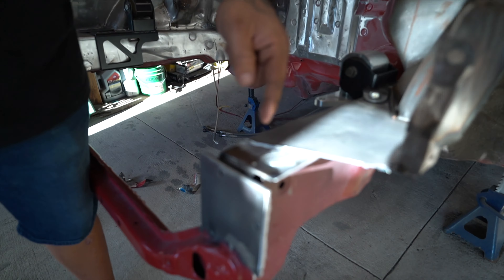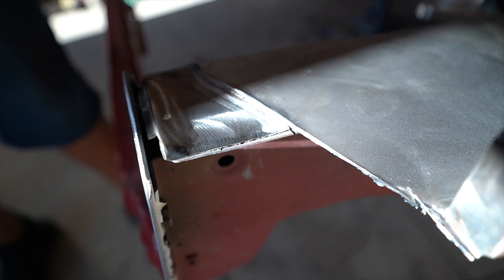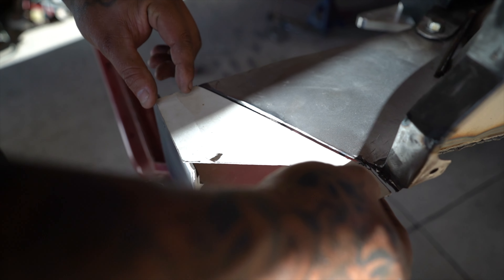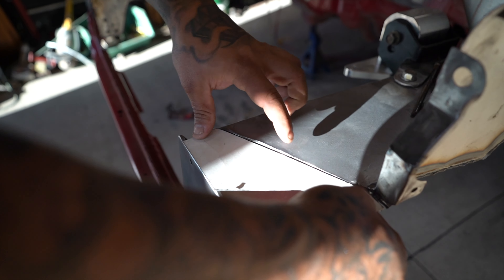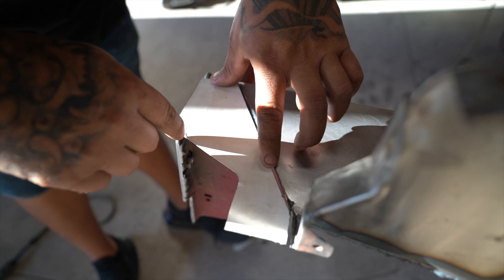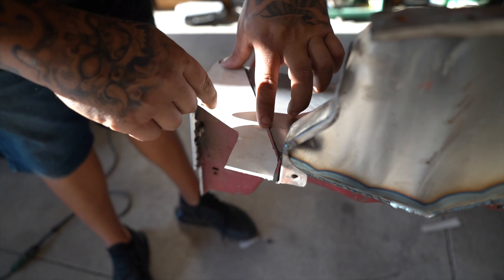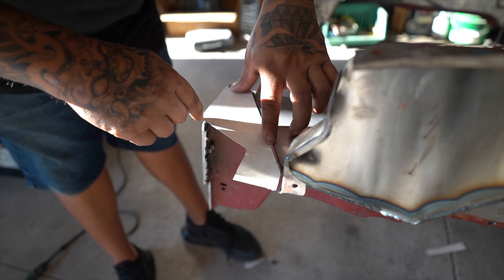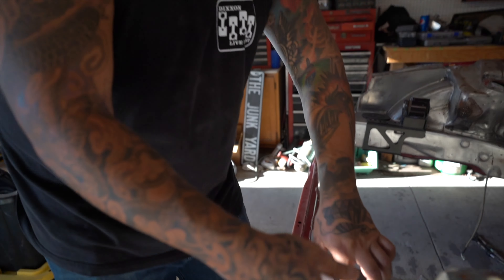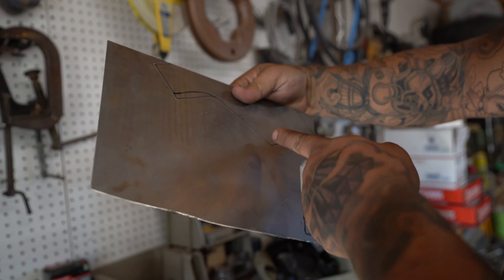It's hot as hell out here. Already got the pieces cut off and prepped. This is what the top side used to look like — OEM was super wrinkled, it looked like crap. So the new piece of metal could follow OEM or I might give it a radius right here. I think it'd be a little cleaner with a radius instead of going straight, turning, and going straight again. I might make another pattern to see.